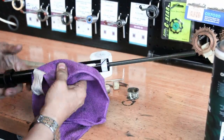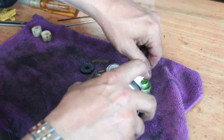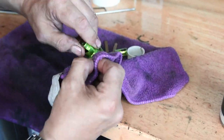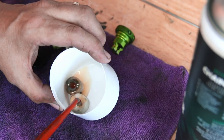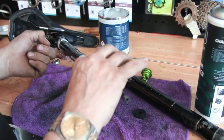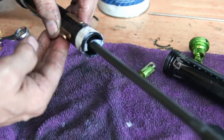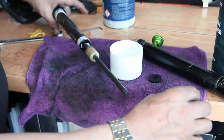We cleaned it up using chain cleaner rather than degreaser because it evaporates and is better for this kind of work — it has good pressure to wash parts off. We cleaned all the keyways, degreased everything going back in. The little keyways are what cause it to slide, with a brass fitting that moves up and down. Inside is a damper with felt washers; we soaked those in oil, then re-greased the shaft and refitted the keyways.